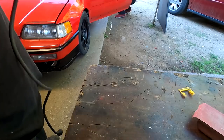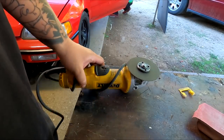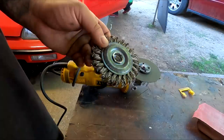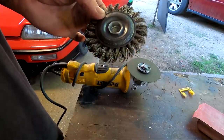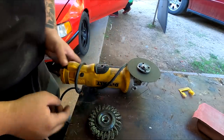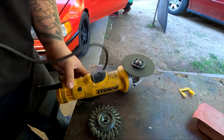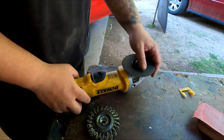I'm not going to waste any time, I'm just going to get right to it. Let's clean up the windshield jam. The quickest and most effective way to take off seam sealer or window glue is to use this guy — it's very scary to use but it works really fast. So go ahead and get this on a grinder. Freaky fast — I caught this on my shirt one time, not the business.